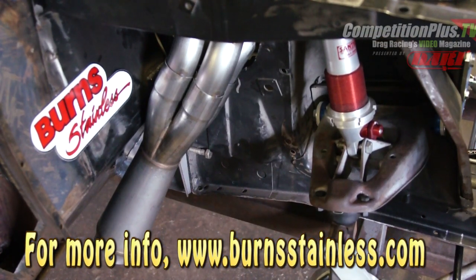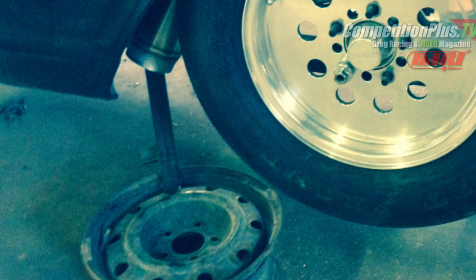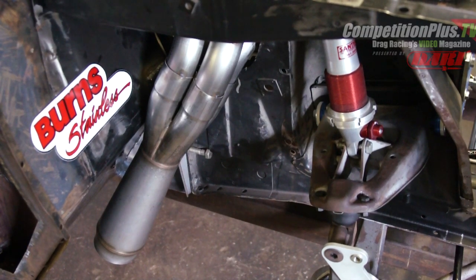Let's go over the collector Jack wanted to use on this car — with the tailpipe and a certain type of wedge for the 18 inches of header collector with the 4-into-1, 2 and 1/8-inch tube that connects to the main header. With Project White Wagon, the header tube has to be short and you need tire clearance with limited room. We actually built a jig to hold the header collector in place so the left and right sides are exactly the same, using a protractor to get the angle correct. Burns makes this collector in various forms, but this is the correct one recommended for Project White Wagon.